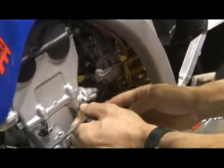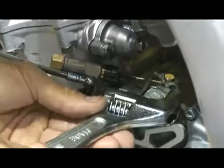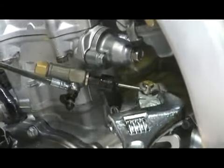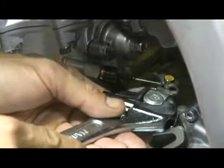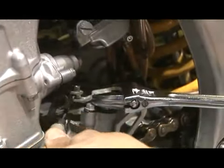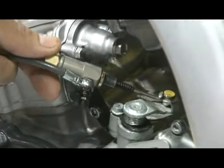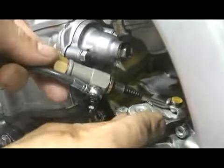To remove the slave cylinder you'll need to use a tool. You want to grab the arm and relieve the tension on the unit, sliding the rod and the boot out of the holding bracket. Pivot your rod out and around, and once all the spring tension is off of this arm, you can pivot it directly on top of it and it allows it to easily slip off.